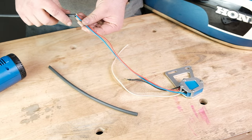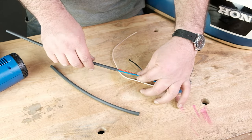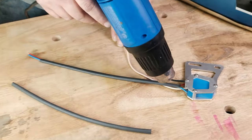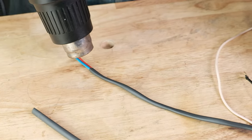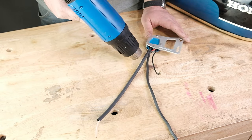The wires will face the side with the longer mounting slot and the LED will face the side with the shorter slot. Place the module retaining plate on top and insert the final four module bracket bolts into the standoff with blue Loctite to bolt the module retaining plate on. Insert your red and sensor wire — the sensor wire can be either green or blue depending on the color of the module and sensor you received — into one of the long 11-inch heat shrink pieces and heat shrink them together using a heat gun or a lighter. Insert the other long 11-inch heat shrink piece over the white wire and heat shrink it as well.